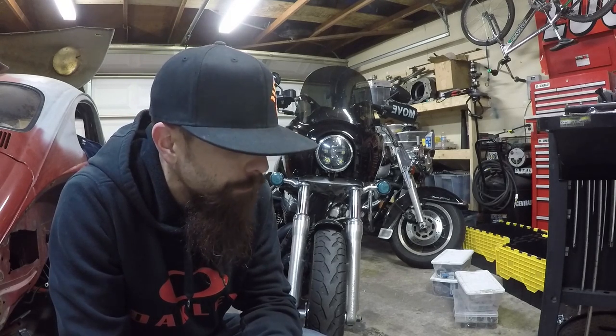did sound like earlier. Probably took the carburetor off three times, maybe four. We thought it was an intake leak on the manifold. So after pulling the carburetor and swapping the slide, putting it back on, having the exact same problem, we pulled the intake manifold off because it had symptoms of an intake leak. You know, the mixture screw in or out wasn't making a difference. No stumble, no nothing. All the way in, all the way out, didn't matter. So we ended up pulling it back off.